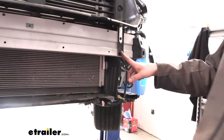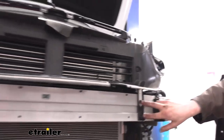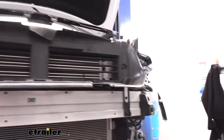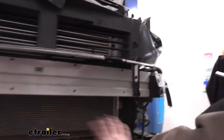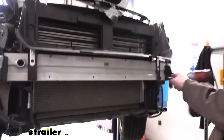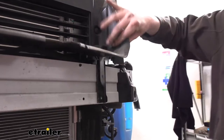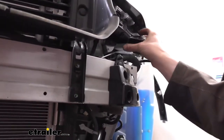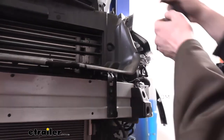The sensor that we removed here, we're just going to fold it back over and poke it right into the hole that the piece we just removed used to attach to — that'll hold it in place right there. Now we'll grab our seven millimeter socket again and remove the arms on each side. There are two here and one there — this whole center piece we're going to take off. This piece we are going to be reinstalling, so that's why we cut off the other stuff. When you remove the bolts for your center piece, that also releases your horn — just grab that and set it off to the side. You don't want to let it hang from the wire.